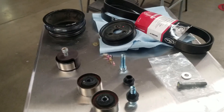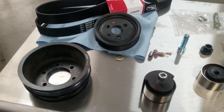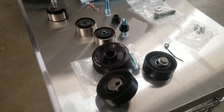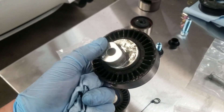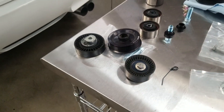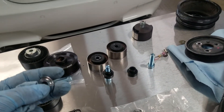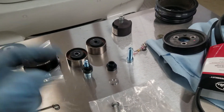We're going to do a retune on this car because it actually doesn't run really well — bank one and two are deviating pretty significantly, almost by 50 percent at certain conditions. This is a good example of why buying any supercharger kit with a loaded tune just doesn't work. You must data log and have it properly tuned in order for your car to have optimal horsepower, torque, and all that. We have data logging capabilities, so I was able to data log the vehicle and fix some of the issues.